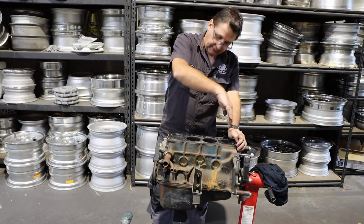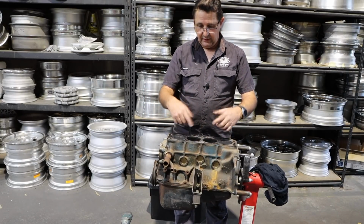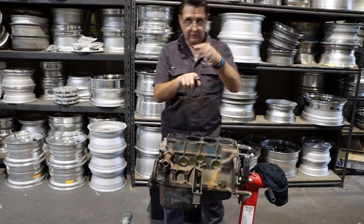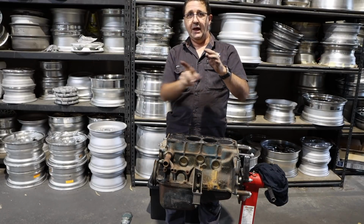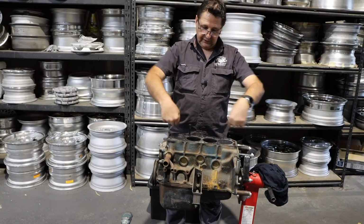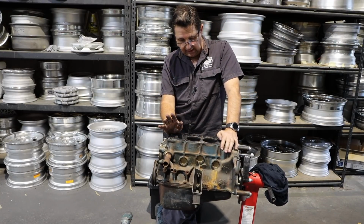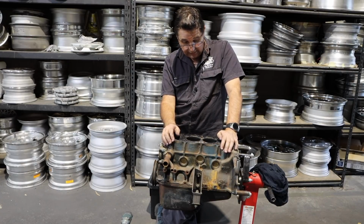linear and crossways. As I was saying before, because your crank's going around like that, there's a sideways action on the pistons, so they tend to piston slap and go this way. These bores are bang on, so either this motor has done no work or it's a fairly recent reco, which is good.